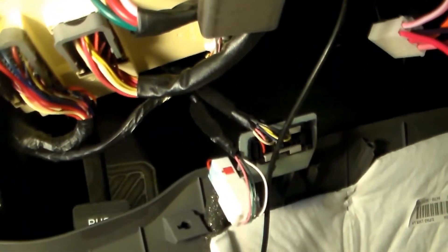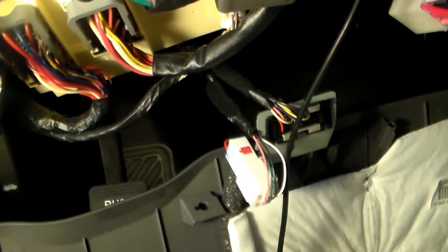I got the main harness connected in here. Everything's taken apart but you won't be able to tell it was ever disassembled when I'm finished. The door locks in this vehicle are multiplexed, so as a result you got to use a relay and a few extra wires. All the wiring is complete and I'll be taping everything up momentarily. I'm about to run the antenna — you can see this little indicator right here that says airbag, which is the side curtain airbags. You're supposed to run the antenna behind the airbag, never in front of it. Always run it behind.